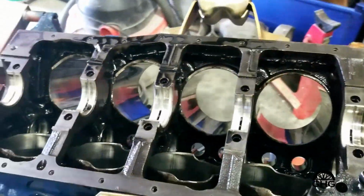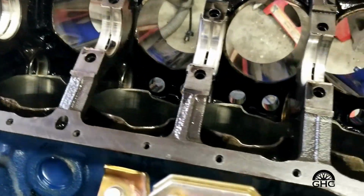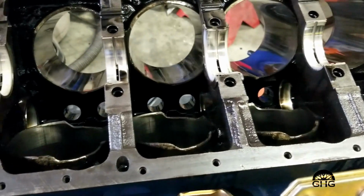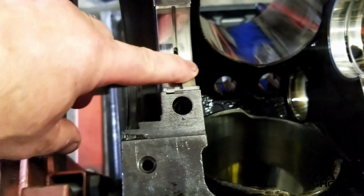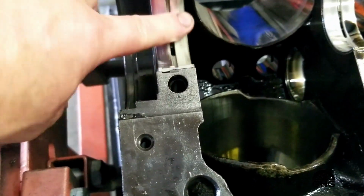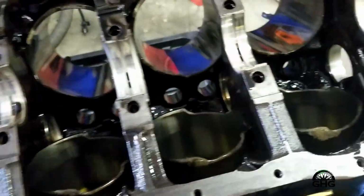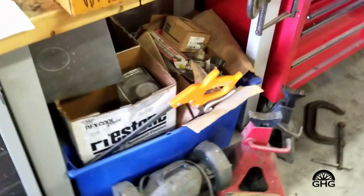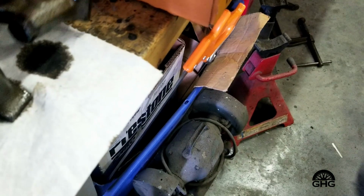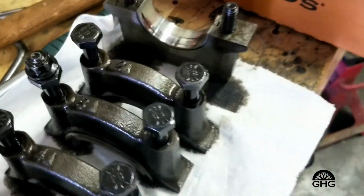Leave some comments. The bores look good, but all the wear on the bearings just look goofy. And I've never seen one like this. I mean, usually you'll see some wearing. Like on this one here, it's all polished on one end, and you still see the Babbitt, the original finish. And it's just like that all over. I don't know if the crank flexes like a rubber band or something. And it's the same on all the mains. Here's the front one. You guys probably don't care, but anyway, we're going to figure this thing out.